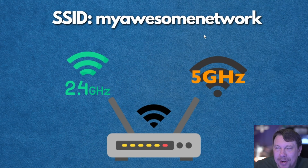Here's how my network used to be set up: I had my SSID with my network name and I had the 2.4 gigahertz and 5 gigahertz networks running at the same time on the same network. When I went to optimize my network and create more SSIDs, I found out my access points or routers can only transmit so much — mine can only do four networks on 2.4 and four on 5 gigahertz. That forced me to separate things out.